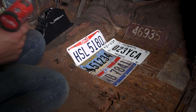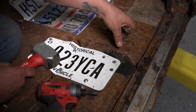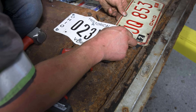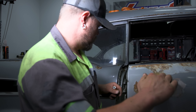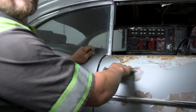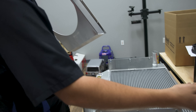Right now we're bleeding the brakes — Bud is pumping the pedal and Hillbilly is under the car hitting the bleeders. Demery's getting a new floor put in on her side. I'm going to throw our thermostat housing on — we have a Summit adjustable thermostat so once we get the radiator in we can position this to line up best and get our radiator hose installed. That's installed. Now I'm about to start putting the carburetor on, getting this thing dressed out so we can make some fire.